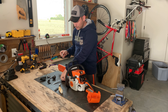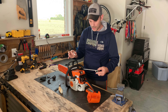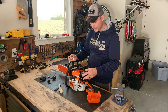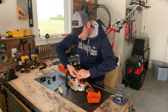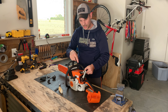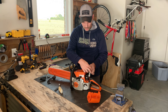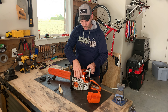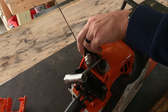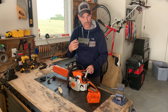What I found — and I don't know if this is recommended, but as a homeowner this was the easiest way — I simply stuck this back in here to where it's touching the engine block. Now that it's back in there, I put my spark plug back in like this, and then I was able to touch my spark plug to the actual little wrench here. By touching it and then pulling the cord, you can determine whether or not you're getting a spark. There we go — I'm getting some spark!